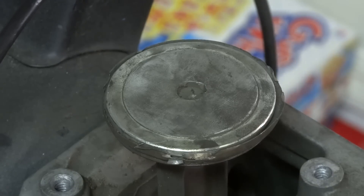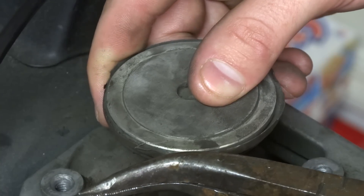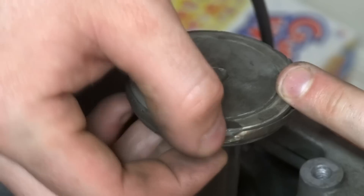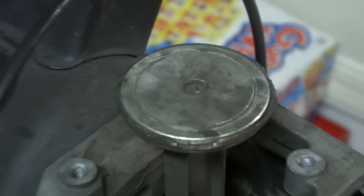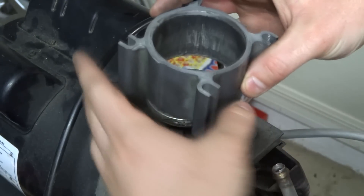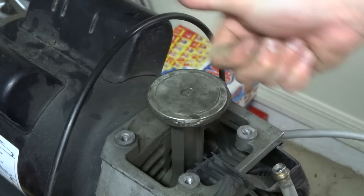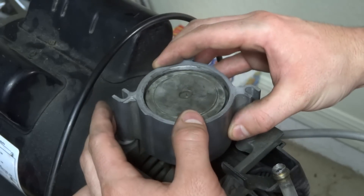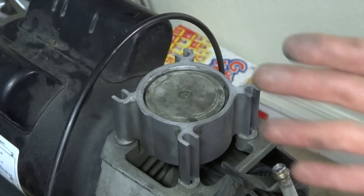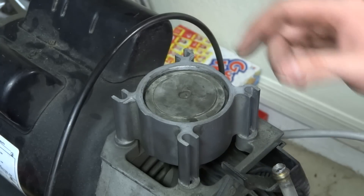When you get real bad dents like that, just grab a pair of pliers and wherever it's really flapped out, put the plier in there — this is all copper — and squeeze and flatten it out. That squishes some of it out and you fold it back up, making it rounder. Wherever you have a gap, put the sleeve over top and you can see down in the hole where it's gapped. Mark it with a marker, squeeze and flatten it a little more, and eventually you'll be able to angle it on there. You're going to get another six months, maybe even a year out of it. As long as the copper is sealing you're going to build pressure. If it's too thin then it'll flap back over, but that's usually not the case — it just wears the outer wall.